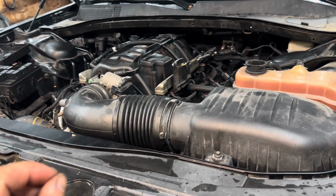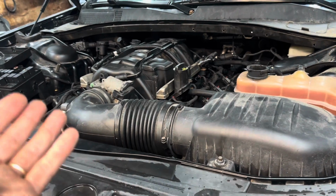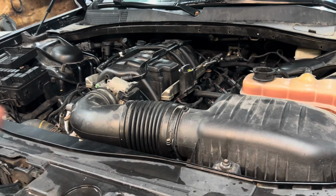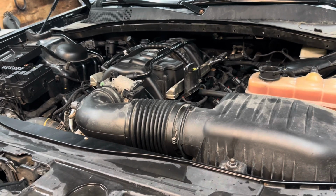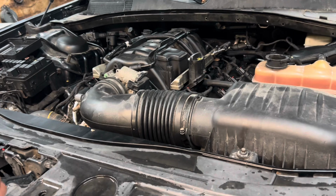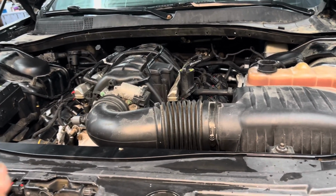I pulled the plug for just a little while, and there was some coolant, obviously, in the oil, but the coolant all settled to the bottom. That coolant came out, then clean oil started coming out, and I put the plug back in. I'm going to start it on that oil. I don't think there's any reason why I can't do that. Like I said, it's a brand new filter, good oil. The coolant sunk to the bottom, and that clearly came out. I can show you right here.